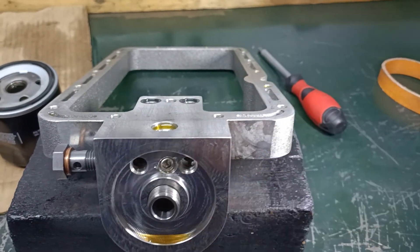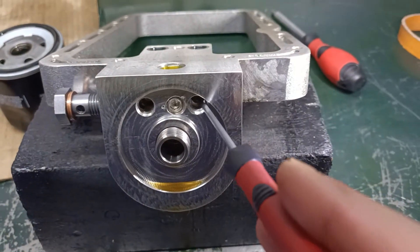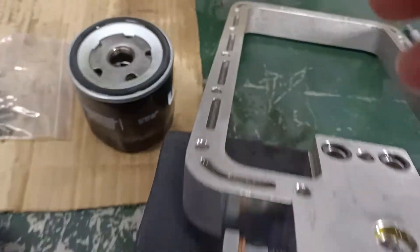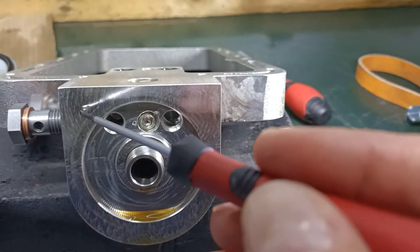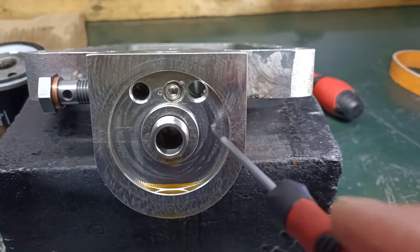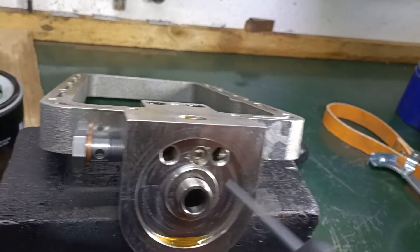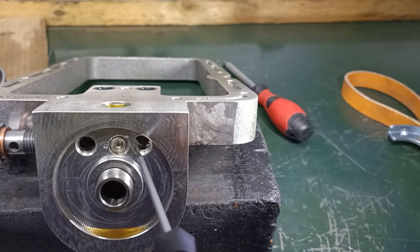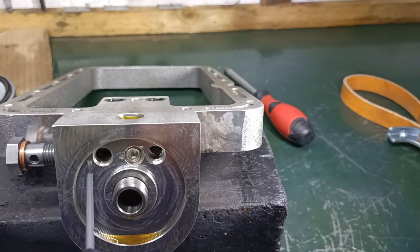What's happening is the oil is coming through here — BMW pumps have quite a push to them. You can see the witness mark there where it seals; this bit sits back a bit, it's recessed. So this whole area is being pressurized with oil. As well as coming out of here and out of there, it's being pressurized here and going out of there and out of there.